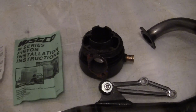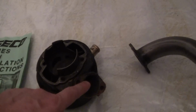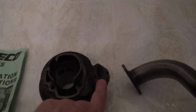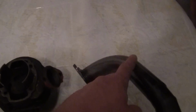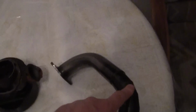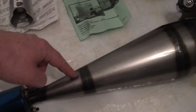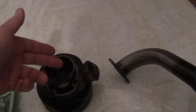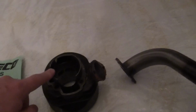And it does that by, on the downstroke, as your exhaust is leaving the exhaust port right here, the sound wave travels, and this is in milliseconds, really fast. The sound wave comes all the way back down to here, like this, okay? And when it's traveling this way, it is sucking like a Hoover vacuum cleaner. It's sucking air and exhaust out of the cylinder.